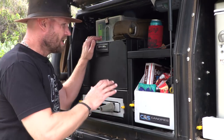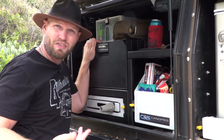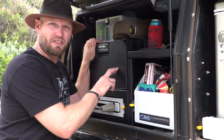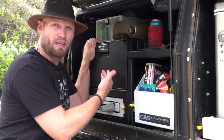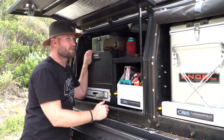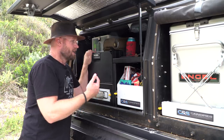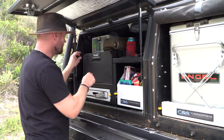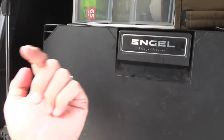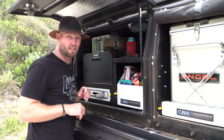Before I get to pros and cons — if you had this in a wagon or in a vehicle that has air conditioning, this would be perfect. It won't have to run as much as it will in a canopy like this. This canopy gets quite hot and it's not very insulated — there's no air conditioning in the back here. It draws air in here and spits air out, so if the motor is at the back, it's going to get that heat in the circulation. It's not going to run as efficiently as in an air-conditioned wagon.